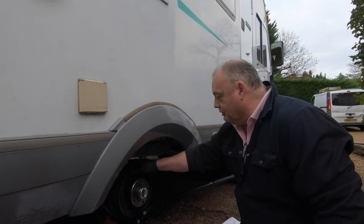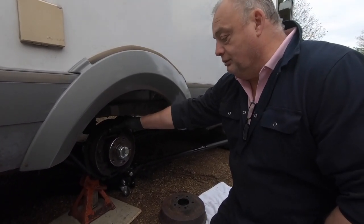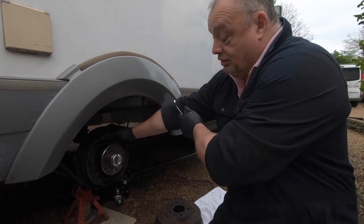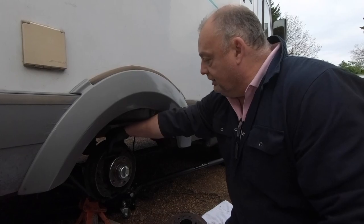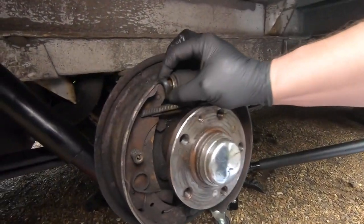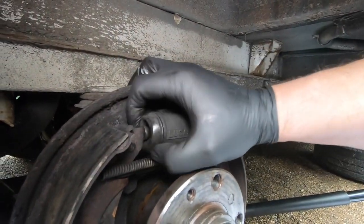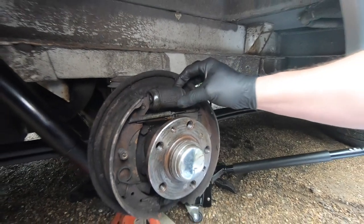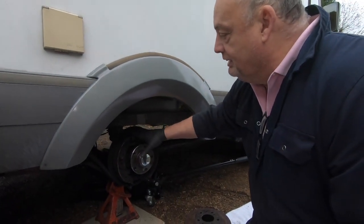It's always advisable, because they're not very expensive, to replace the wheel cylinder, or slave cylinder, but they're commonly known as wheel cylinders. When you check them, always pull the rubber back and make sure there's nothing leaking out there. This one's quite damp, see, so I think that's leaking fluid, so change it anyway. Even if you change the rear shoes and they're not damp, change them, because you're in there doing it. So you're going to clean all this up.